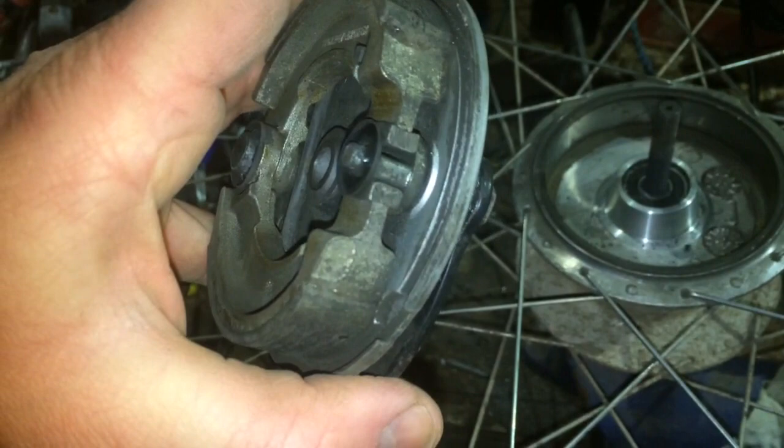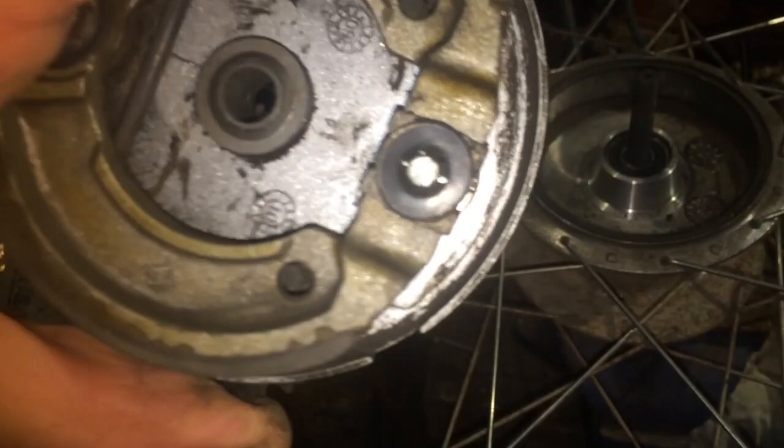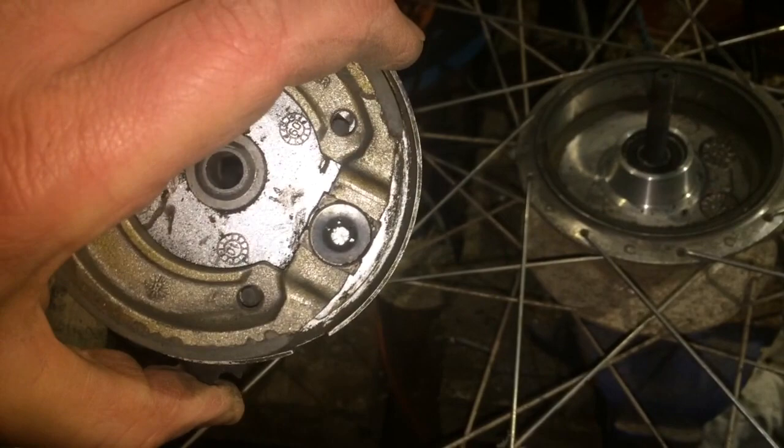When you operate the brake lever, you see this cam here opens the brake shoes. And that's where, when you push it right around, that's the thing that gets jammed. So I'll show you from the top so you can hopefully see them open — that's all it does just to work. Pushes apart these brake shoes, and the brake works just like that.